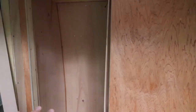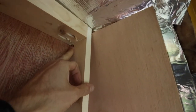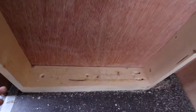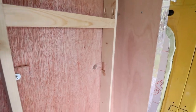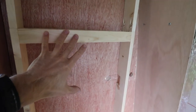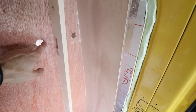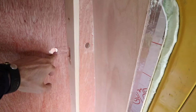The front of it is 12mm ply — I got one whole sheet and cut out the door. For the side of the shower I put in a stud frame and secured it to the roof of the van with a self-tapping bolt, and also secured it to the base of the van. This side is 9mm ply and the other side will also be 9mm ply, sliding in and secured with small L-brackets to pull it out to the frame. The pipes will run in here and connect into the faucet for the shower head.